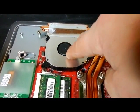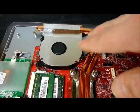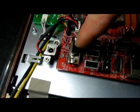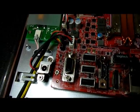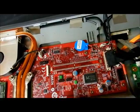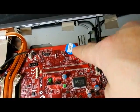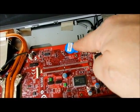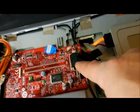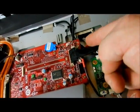I see there's some dust in there, so I'm going to take a compressor and blow this out — get all the dust out while the top's off. That's what I do with all computers anyway. There are your memory chips, and there's your VGA connector I pointed out before. Up here is the battery, and it looks like you're going to have to order it off eBay or from MSI — it's not a generic, it's got a plug, so you'll have to buy the whole assembly. Up here is your camera and your microphone. This is your connection to the monitor.